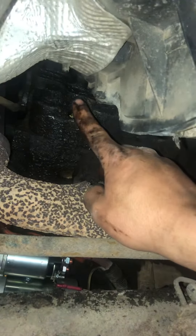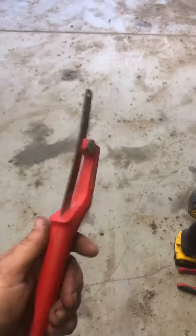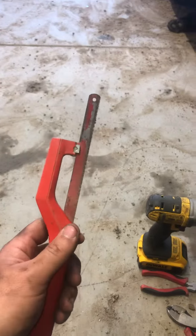That way I don't have to — because then you'd lose all your pressure and your AC lines. They told me to go ahead and remove the inner fender, and then on your air box it's molded and kind of stuck together. There's about an inch flap that sticks out — that's what stops that rail from coming out. They said just use a pair of side cutters to cut it out.